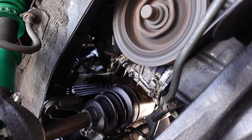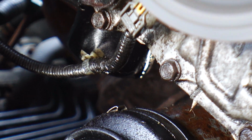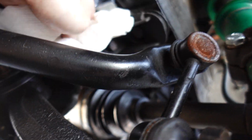All right guys, so I was super wrong about the switch. This thing is leaking from the oil filter pretty clearly. Let's take a look. As you guys can see right up in here, I'm sorry, I know it's loud, but the car is running. She's dripping up on the filter, and then way up on our switch, I think it is leaking pretty slowly. Definitely way slower than from the filter, so let's shut this thing off and try and get this filter a little tighter too.